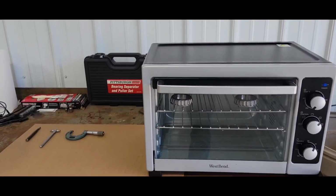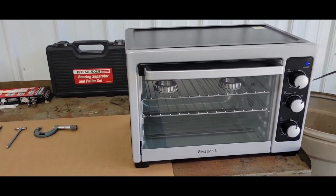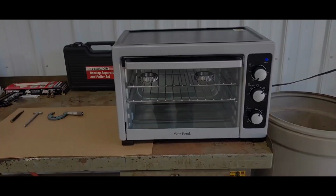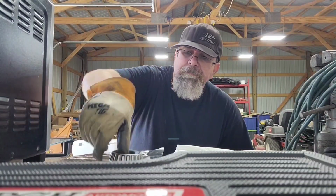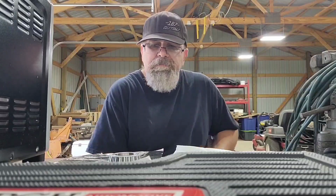The carrier is in the freezer, and it's about as cold as it's gonna get. I got it down to a thousandth from where it was. If I grow these about 2, I should be perfect. Time to measure. About 10 minutes and 350.